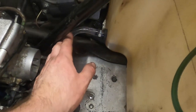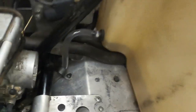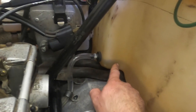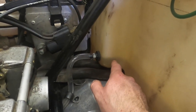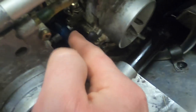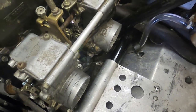Now these little guys — this is your gas line, that's your feed from the tank. Another thing that's not necessarily a fire issue, but back inside of here is a pickup tube and a filter. Once they get this old, like 15 or 20 years old, you need to check those and make sure that the pickup tube and the filter are still in one piece and in good shape. You've also got these lines and down in there is your fuel pump. This blue line is one I've already replaced — that's a brand new line. You need to go through and change these lines off the fuel pump. When you get a sled that's 20 years old, that's one of those things you just need to do.